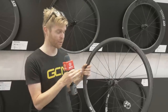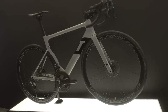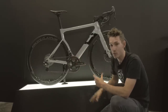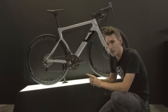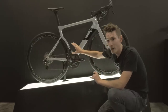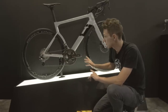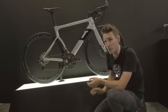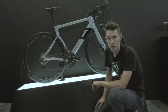This is a bike I was really interested to come and see — it's the 3T Strada Due. It is the evolution of the 3T Strada, which I was pretty excited about when it was launched last year because you could not run it with a front derailleur. It had to be used 1x, which on a road bike was pretty revolutionary, and it caused quite the controversy. Now, though, we have a 2x version. Interestingly, 3T say there was always the intention to launch a 2x model as well — the original carbon mould actually had the mounting points for that in there. What they've done is beef up the carbon layup, adding about 35 grams. My other question was how much of an aerodynamic penalty there is running 2x as opposed to 1x, and they've said 8 watts, which is pretty significant on an aero bike. So: 35 gram penalty, 8 watt penalty, but you get a front derailleur. It pays your money, it makes your choice.